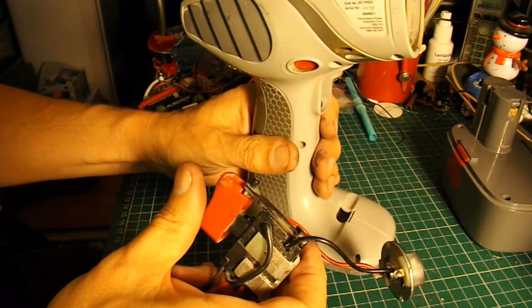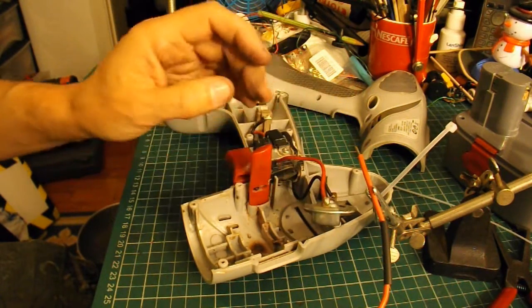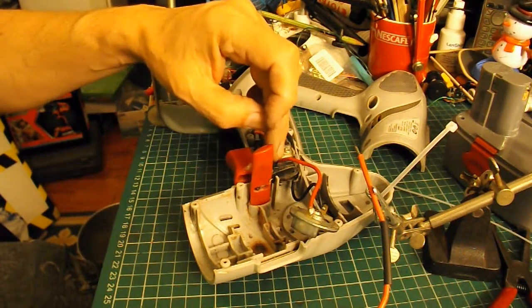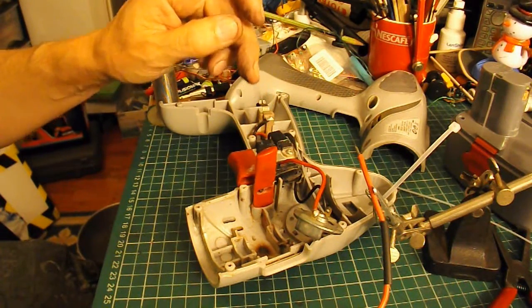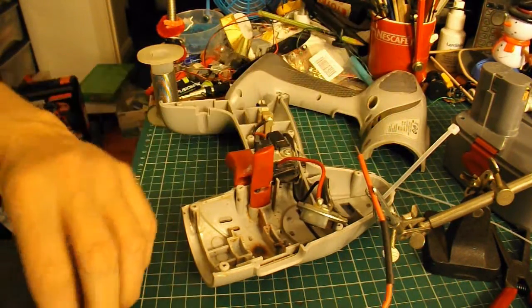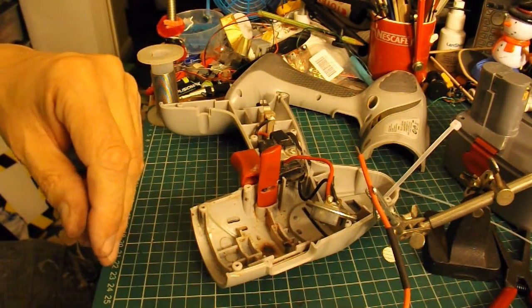It'll look a bit odd, but it'll do the job. So what we're going to do is desolder the wires from the old motor housing. Ideally I'd just replace the wires all the way into the switch, but the terminations in the switch are single use — I can't take them apart and reuse them, not without completely disassembling the switch anyway. So we're going to desolder the existing wires, solder on some nice longer wires, and on the other end put this electrical connection block that'll just hang out of the housing, so I can connect whatever I like to it.